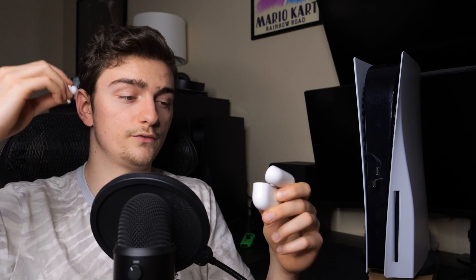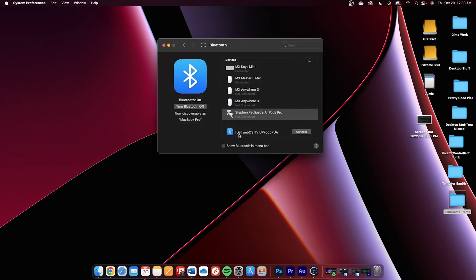If you're done using your AirPods with your PlayStation 5 and want to reconnect them with one of your other devices, put the AirPods back into the charging case and close the lid. Next, take your Bluetooth dongle out of the PlayStation 5. Then open up the lid on your AirPods again, take them out, and they should reconnect automatically with the previous device they were connected to. If they're not connecting automatically, go into that device's Bluetooth settings, go to the Paired Devices list, select the AirPods, and then they should connect.